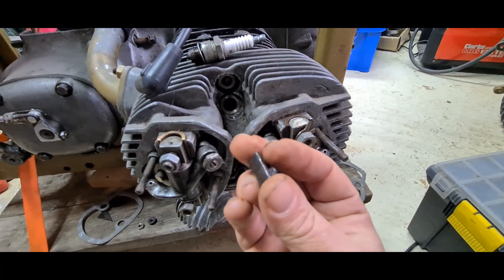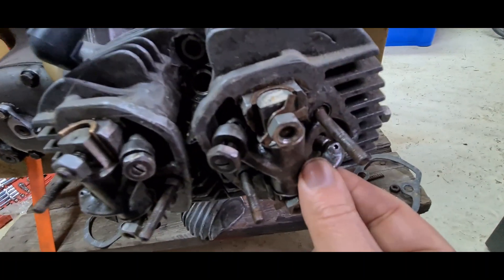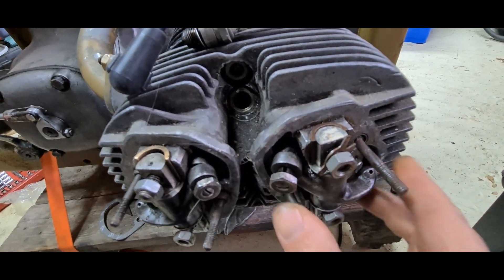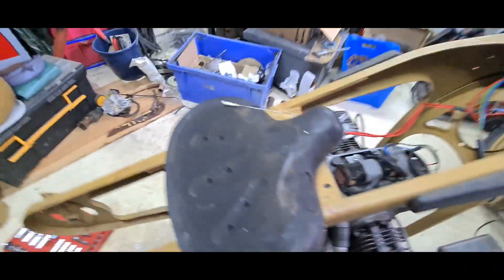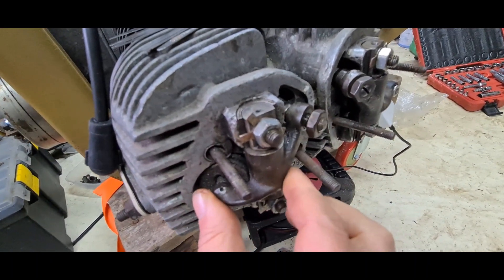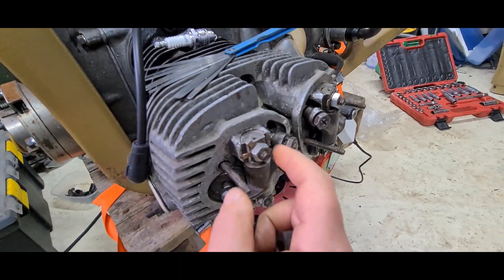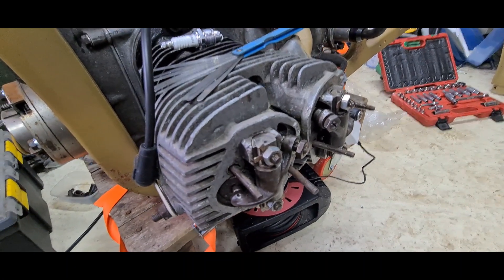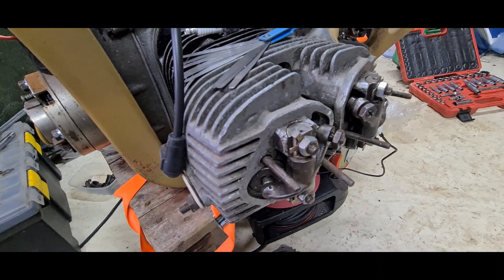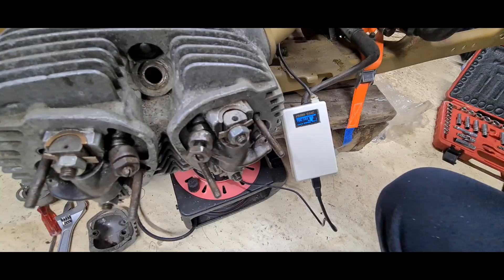That's back in, and I've used those bronze packers as described to adjust the float, along with the washers. If we look at this one which is now done, it's got very little float on it — nice and quiet, so it'll rock nicely without bouncing around. If you look at the other side, that one hasn't been adjusted and you can see it's got a lot of float — it'll make a hell of a noise when the engine runs. Frustratingly, while greasing the needle rollers I lost one and can't find it anywhere — they're 2.3mm steel, so I'll just have to make a new one. I'm going to quickly whip around and do all of these now.